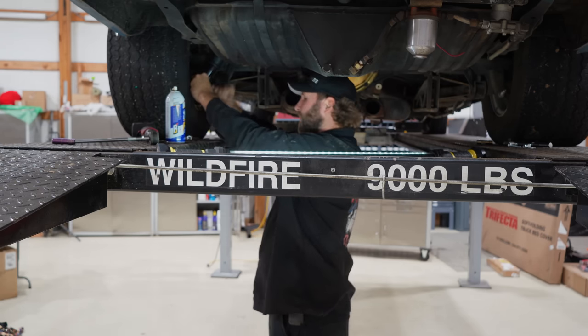So I'm gonna get a vacuum gauge on this, fire it back up, go around and just do quarter turns. And it's gonna take a bit with four corner, but we're gonna try to get this to where it idles nice. We don't wanna be fouling plugs idling. All right, that vacuum gauge is plugged in up front there. Let's fire this back up, see if we can get it to idle.